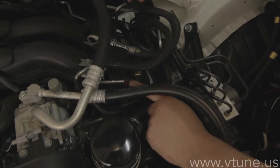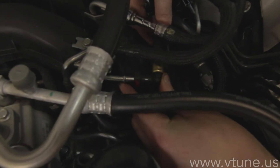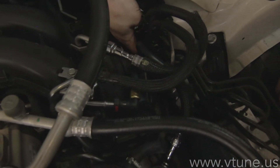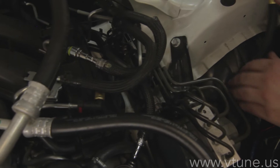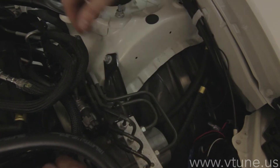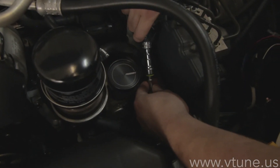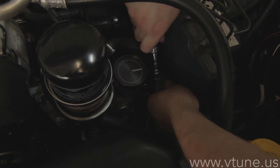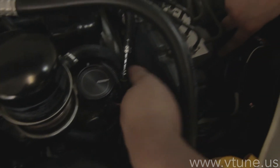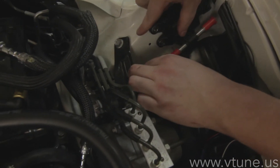With the quick disconnect off, you're going to want to connect the connector with the red end and it will click right on. You can see it's going up and behind and underneath the brake booster, coming over the top on this side. Now your standard fuel line that you've disconnected is going to route down and connect to the male line and it will click in. That again goes underneath the brake booster or the brake ABS sensor, and this is where you mount your sensor.